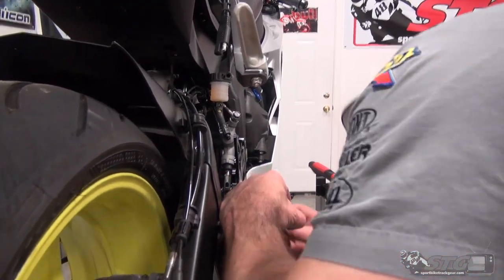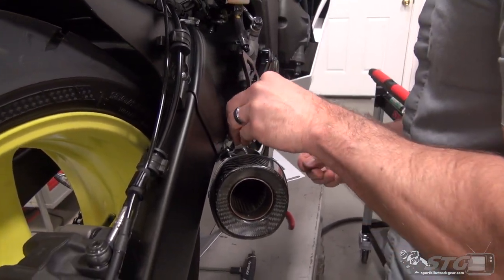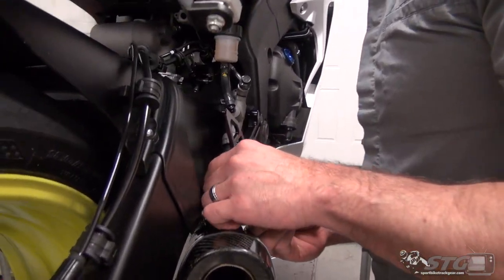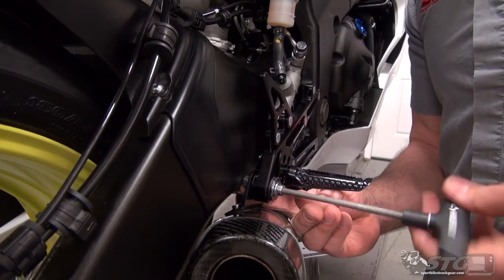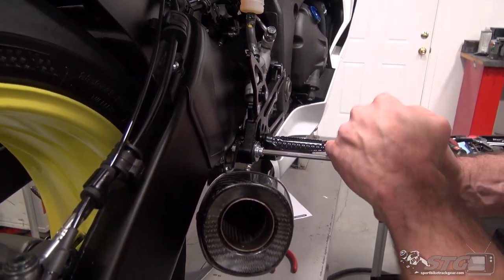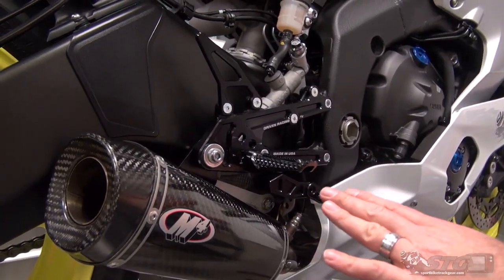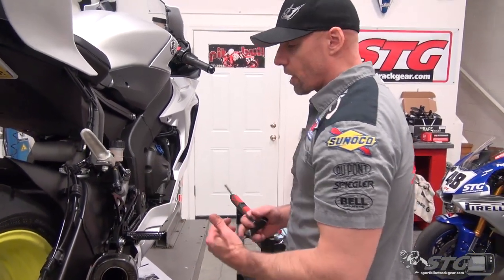Last but not least is our exhaust mount bracket. Look through the hole, kind of get that lined up, put a little downward pressure on the exhaust to make that happen. Here I'm just reusing the hardware we had in place previously. I've got the fastener pushed through — it's kind of tight back here with the tolerances. Get the nut back in there, draw this all up. That's a serrated nut so it's actually holding itself in place while I torque it down. And there you go — there is your brake side. Before you ride the motorcycle, make sure you wear the footwear you use when riding the bike to adjust all your foot controls before you take it out. Now we're going to go ahead and work on the shift side.